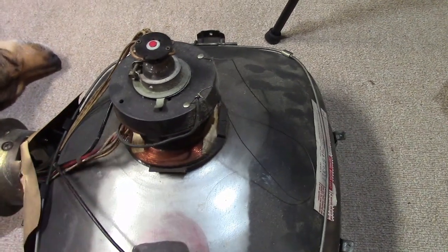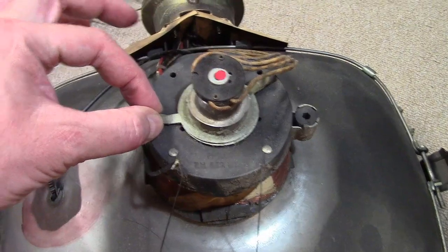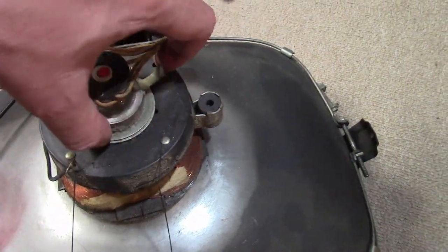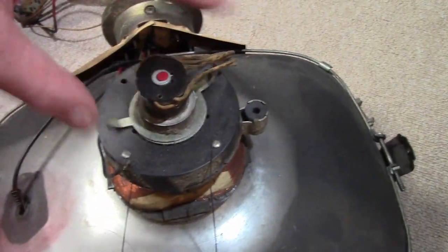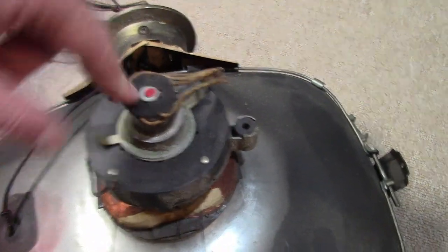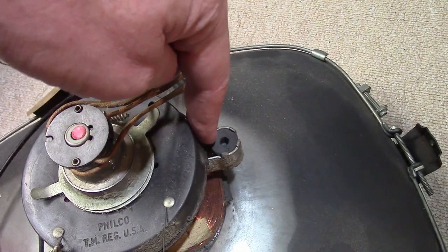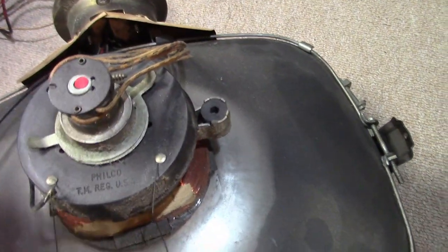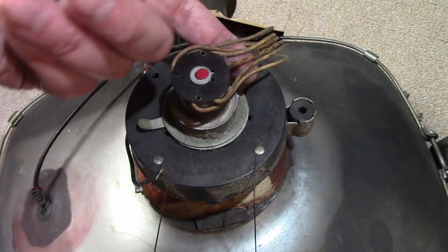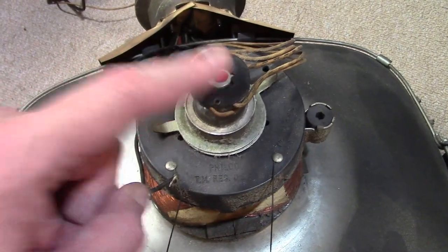There are two types of CRT. This type has concentric magnetic rings for centering — little ears here that rotate. You rotate them to center the picture tube. I'll do a separate video on how to do all the setup. That is a magnet — it's powdered. You can put an Allen key in there and rotate it to adjust horizontal linearity. It's very brittle, be careful not to crack it. And then this is your connector to the base of the CRT — don't put pressure on that, don't break that off. That's a thin glass nipple there.